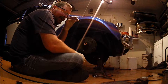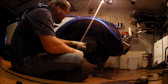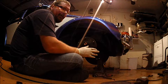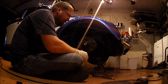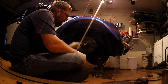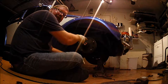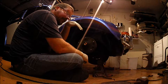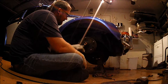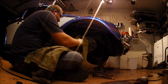One thing I'd definitely recommend for any Volkswagen '66 and earlier — originally this car would have had double jam nuts on the spindle. They work good as long as you install it right and hold the tab over. What usually happens is somebody forgets to hold the tab, or doesn't tighten them all the way, or over-tightens them. When they over-tighten them, they strip the threads and then you need to get another spindle. If you do have original jam nuts, I definitely recommend upgrading to the aluminum clamp style.